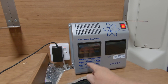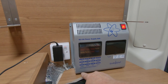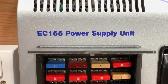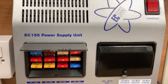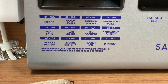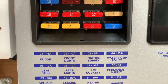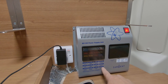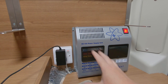On this side you've got all your fuses for things like the fridge, so when the engine's running it will supply power to your fridge and vent fans in the roof, front lights, rear lights, and ignition supply. This connects to the vehicle's 12 volt system and has an intelligent 12 volt charger to charge your leisure batteries. It also handles water pump, toilet pump, 12 volt sockets, permanent supply, vehicle battery, leisure battery, heater fans, and the charger.